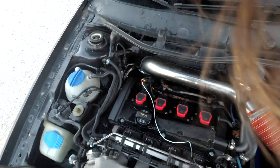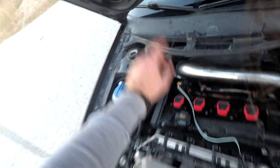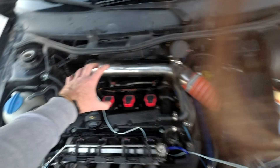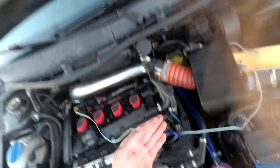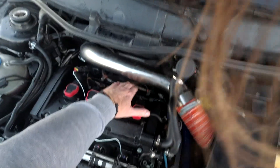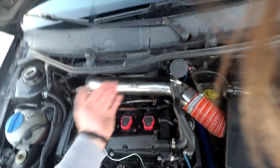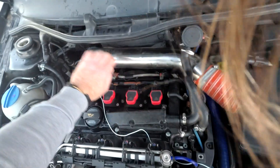That's just a quick video on why I don't like these. You have to be careful that they're not touching anything in the engine bay, or it's going to cause damage — wear holes in things. God forbid it wears into a cable, you've got a short. If you are going to use them, either be ultra careful that they're not touching anything, or do what I've done and sleeve them, which has been fine.